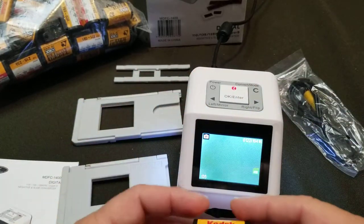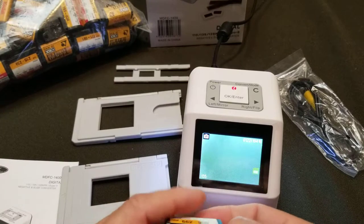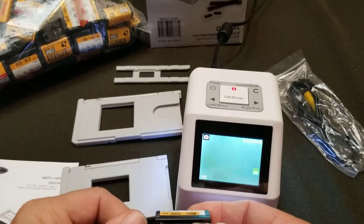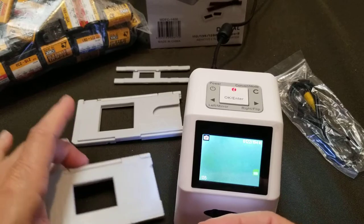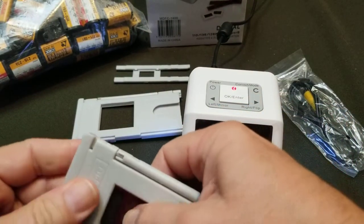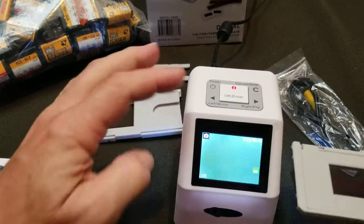So for the Advantix film, simply open the case and slide door. I'm using an R2 square bit — fits nicely — which allows you to rotate the film out. Using the 35 millimeter holder, slide in the film and get it so it's just at the edge. If you have it sticking too far out, it will snag as you go through the system.